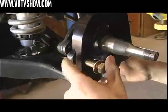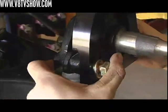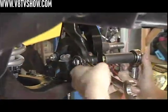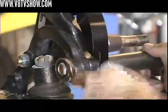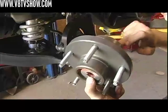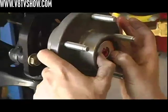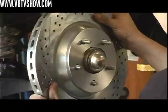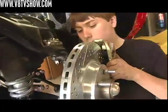Baer supplies hardware to make this happen. Once you put the new bolts through and torque them down with the lock nuts, you can slip the new hub on. It's a two-piece hub and rotor combo, which is nice because it's a little lighter than the original and keeps some heat out of the hub. The hub slips on and locks down with a traditional style hub nut, then you slide the new 13-inch rotor on — zinc-washed, directional, drilled, vented, and slotted — and slip the calipers over the top.